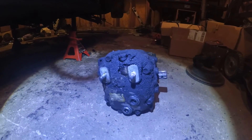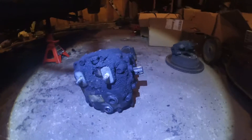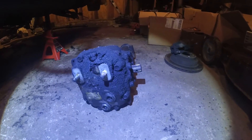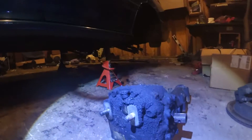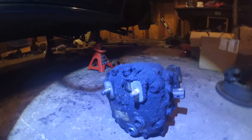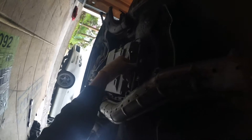These things right here are a huge pain in the ass — they're bolted together so you have to slide them all the way out of the diff before it'll actually come out. I got it out — you couldn't really see it in the video, but I just pulled it out towards the front of the car and it slid right out. This one is just covered in more grease than I've ever seen, so it's probably gonna get thrown away.